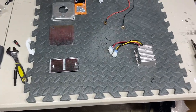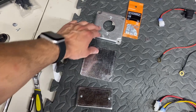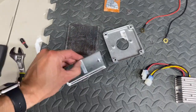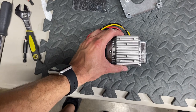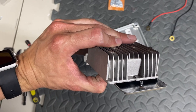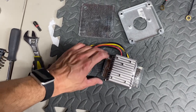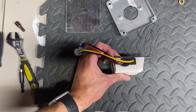The most space I have looks like it's right up here over the top of the charger — I could run some self-tapping screws through that plastic. Here are my ideas for mounting to something metal in that cabinet. I picked up these electrical box connectors. My initial thought at the store was to grab a couple options, and I think this double-gang plate is going to be the winner. We'll have to drill some more holes. I'm going to mount the converter to the box with the hollow side, so it's got a little standoff to allow heat to dissipate on that back end, using some washers, and then screw it to the plastic.